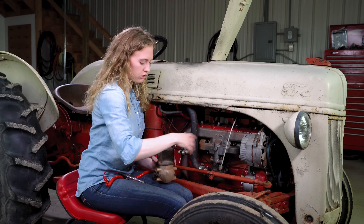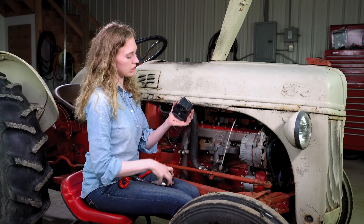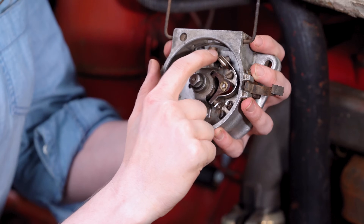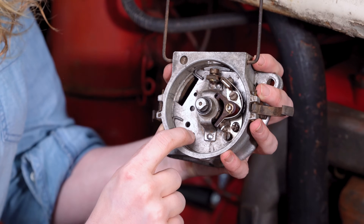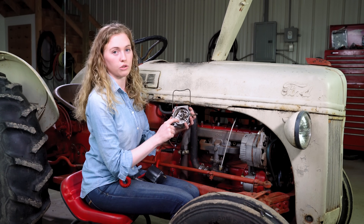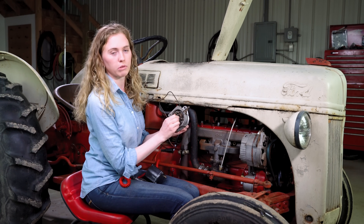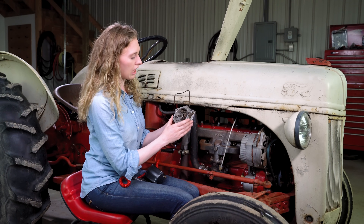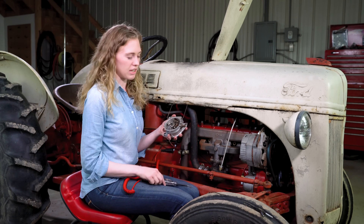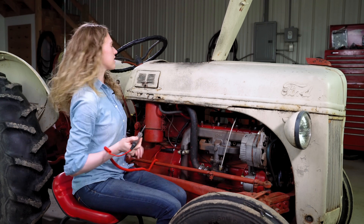Let me show you. I have a distributor torn apart here to show you what happens when we do this test. This little probe on the bottom of the coil has to touch the screw right here, and that connects all the way around the points and then grounds. When that light is flashing on and off, that's telling me that the spark is going through the coil, all the way through the points and then to ground — it's working properly. This will flash on high lobe and low lobe — that's the open-close, open-close, the light on and off that you see on your testing tool. This tool will really help you pinpoint exactly where the problem lies.